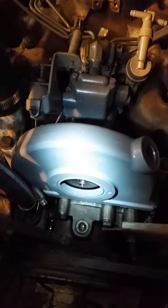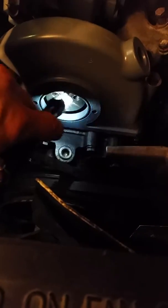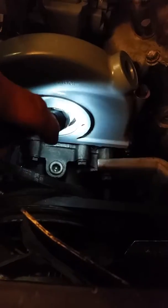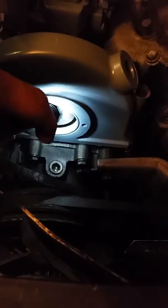This is a very delicate procedure as you may disturb the timing of the gear which is right here inside. If this gear is disturbed without making marks or whatnot, then you will lose the timing of the camshaft to the timing of the injection pump and your fuel injection will be off.